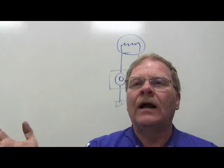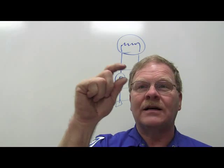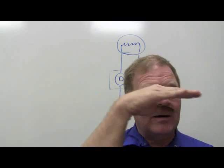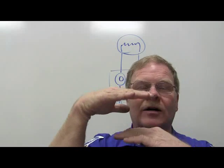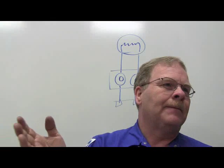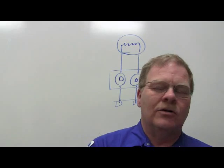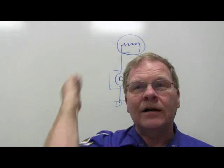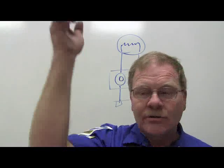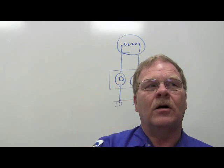And that water is going to do what? It's going to go to the bottom, and it's going to sit there. There's going to be a line you can see where the gas and the water come together, because that's how gas and water do, right? If it's got alcohol in it, that alcohol likes the water better than it does the gasoline. So you put a cork on that, and you shake it up, and you set it down. However much water you gain is how much alcohol you got.